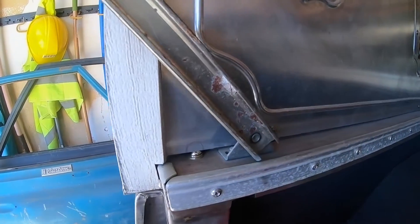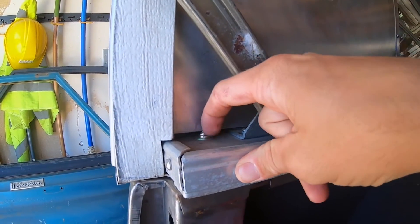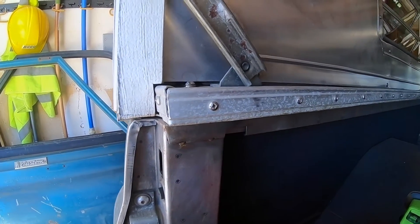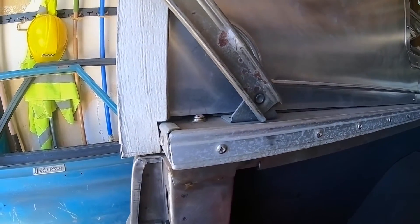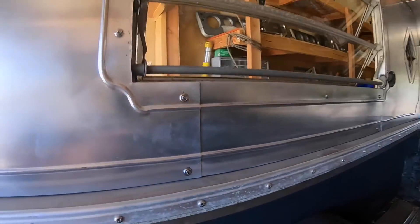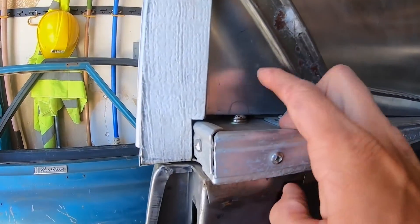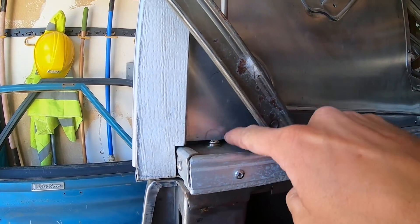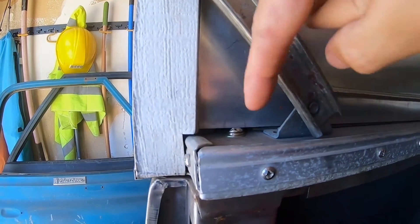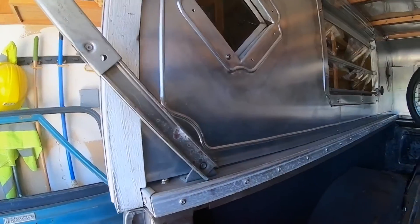In other videos you've seen how my camper shell is attached — allen bolts run down into a wooden stud I made for the stake pocket holes. I'm getting close to TIG welding all these seams together, so I want to make a forming die out of wood so I can make an indentation right here that recesses back, allowing me to tighten this up without having to remove this panel.